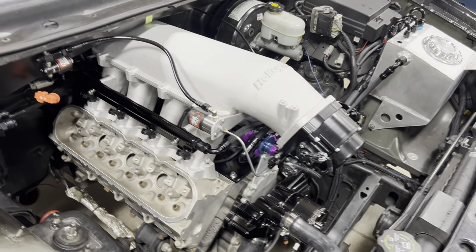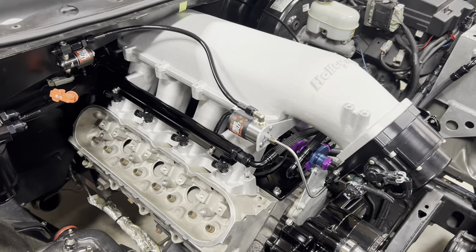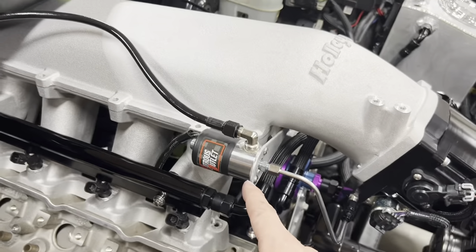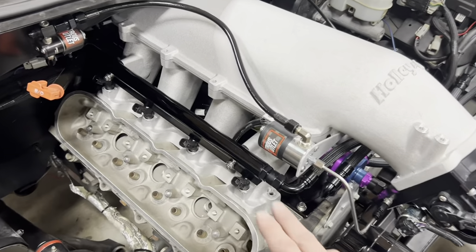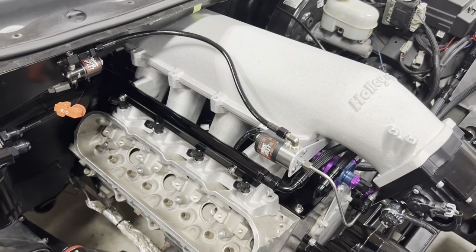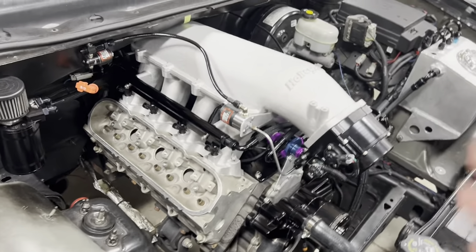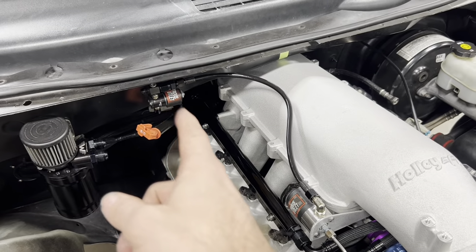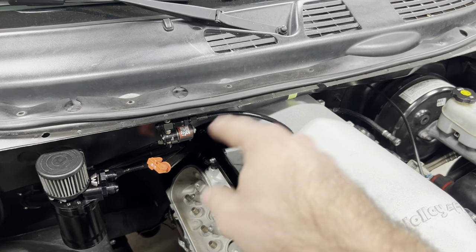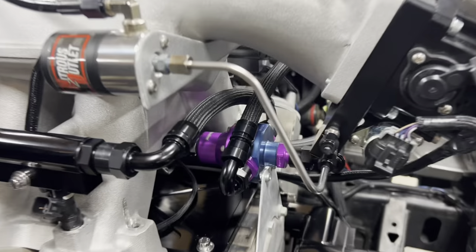On the nitrous side, we've pretty much got everything mounted and mocked up for final assembly when we get the engine back. We made a bracket to hold our nitrous solenoid — we're not going to be doing a wet shot like we did in the past. We're only going to have a single solenoid and we'll be adding fuel through the fuel injector within the Holley software. So basically it's a dry shot. We've also got the purge mounted back on the firewall and we'll run a short purge line out underneath the hood.